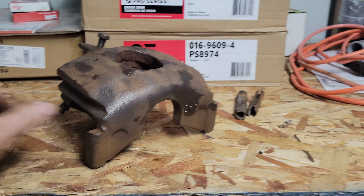Brake line screw is good, caliper is still good, boots are good — this thing is ace! I'm going to brake clean it to get the oils off, and then grease all this stuff up with brake grease obviously. I like to grease these up so nothing sticks and there's no noise when you're applying the brakes.